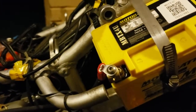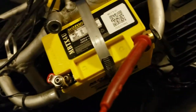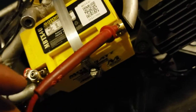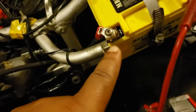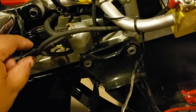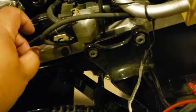I'm going to show you the voltage you get from setting it up this way, and show what you get when you're not on the starter button. I have my volt meter attached with the positive end to the positive side of the battery. The negative end of the second battery is connected to the starter solenoid. In this test I'm just testing the voltage, not whether it starts the bike.